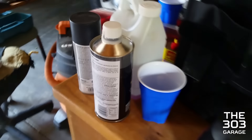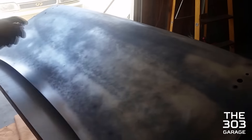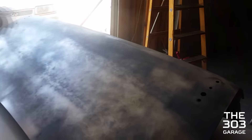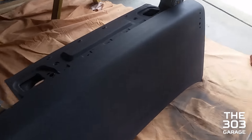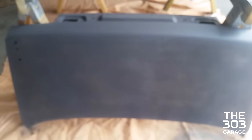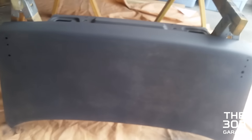Look, you can see David's face in it. So we're just sanding the whole thing with 320, and then we put some mineral spirits on it and we got primer. We've got a couple light coats of primer on it and it looks pretty good. It's a little rough, but that's what primer's supposed to be. We're just gonna do it until the can's done — it's got about two or three more coats left in it, very light coats.